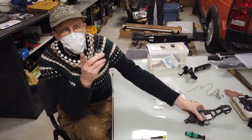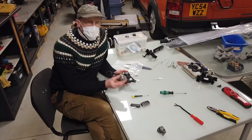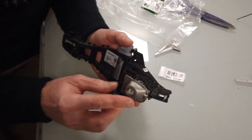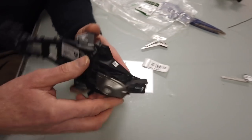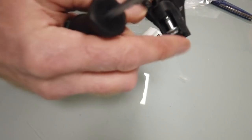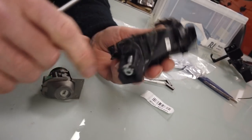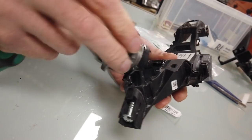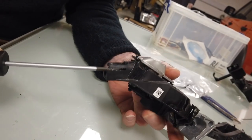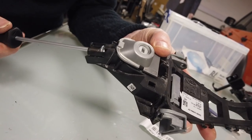So we have the lock. This is the inside of your door handle and this is the barrel. You take the key barrel and slot it in there. Notice it comes in at a weird angle, but the clever thing is the screw in here is captive — it cannot fall out because it's got a little cage it lives in. The barrel slips in and then you screw it in, and that locks the barrel in place. We're going to show you how to do that on the car.